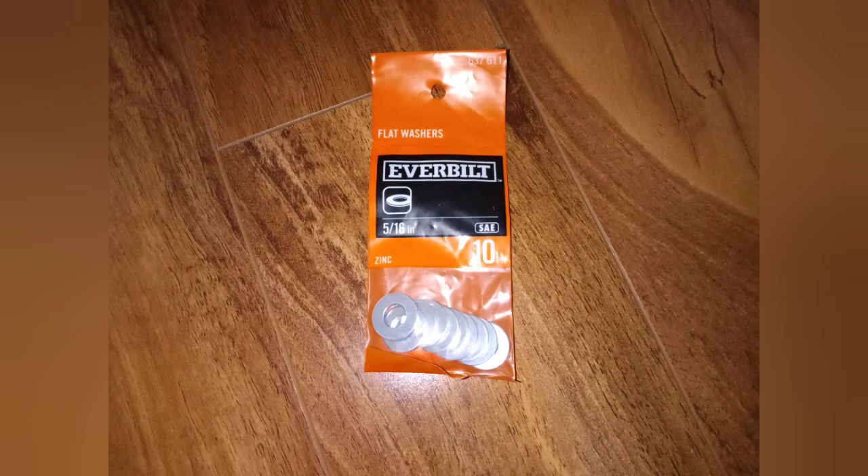So what do you do? I'm not about to go back and redo the whole thing. So I sat and thought for about half a day — wait a minute, if that bolt bottomed out, I just need to add some washers. That washer will extend the bolt out a little bit, and I'd be able to compress the whole valve cover a little bit more.